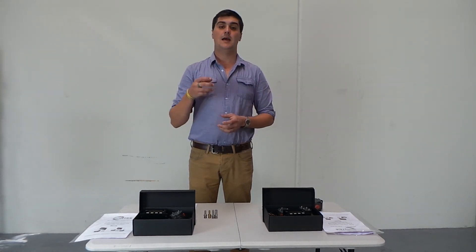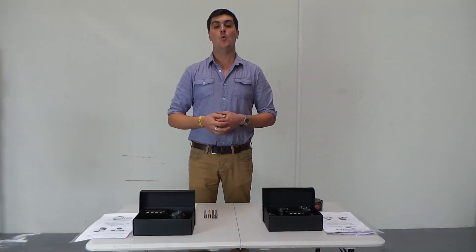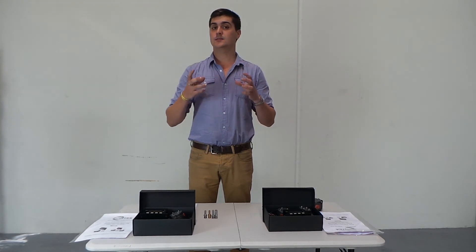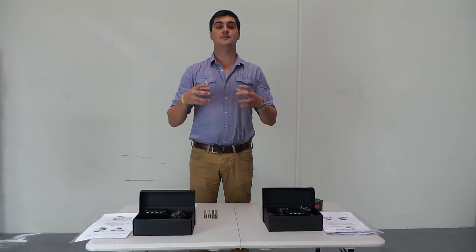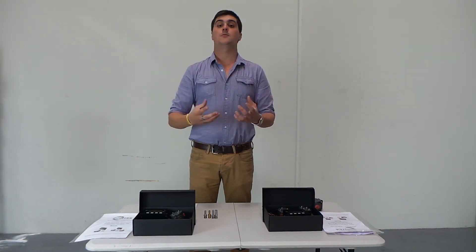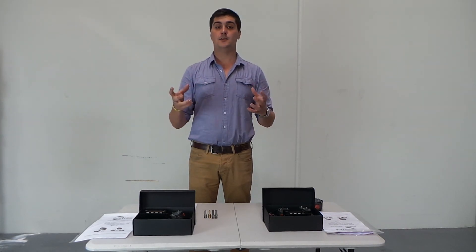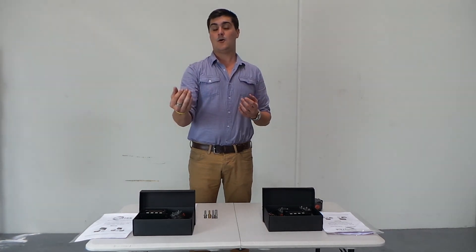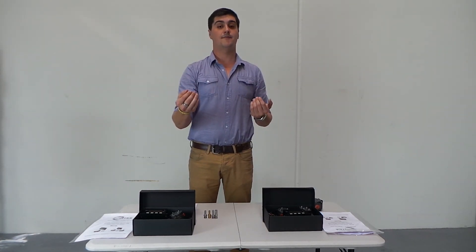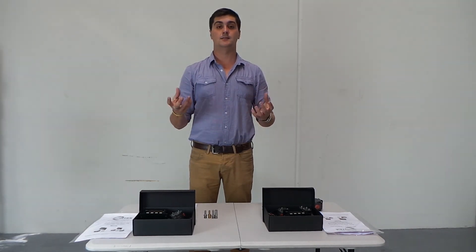The standard kit comes with a 5 litre to 150 litre an hour pulse meter. What this means is not necessarily that your engine uses between 5 and 150 litres per hour — it is that the flow rate is over 5 litres an hour and under 150 per line. This could mean that your supply line might be giving your engine 50 litres an hour but the return line is giving 45 litres an hour, giving an overall usage of 5 litres an hour.